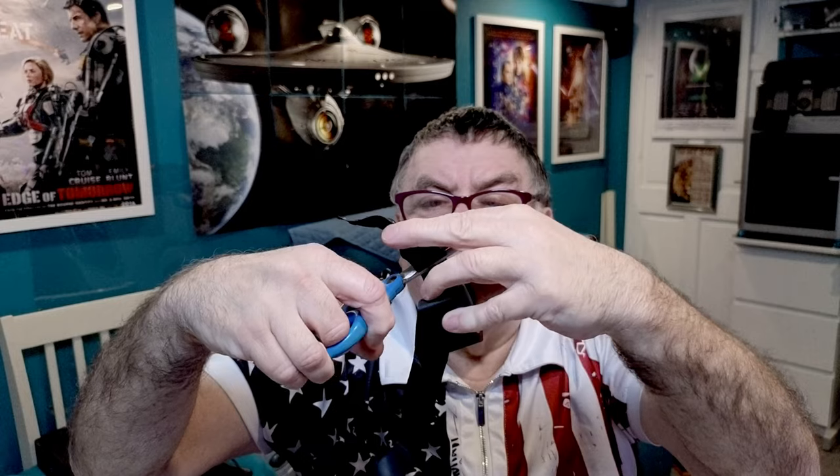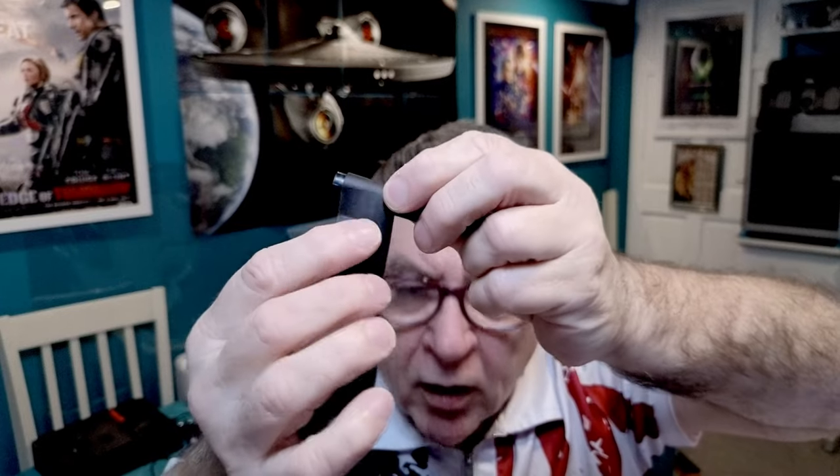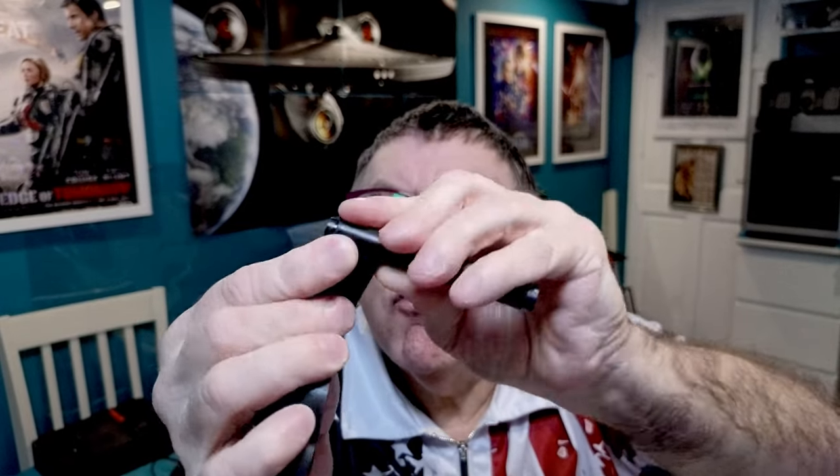And like I said, this one, I used this stuff. So I'll show you putting it on the old one. Like I said, that's how you get the tape. It's got a protective sort of wrap on it one side, but there is no adhesive as such. It just relies on the stickiness of the rubber, hence its name, self-amalgamating, the fact that it self-amalgamates with itself under heat. So you would sort of start it off, trying to work backwards to the camera, but you'd start off, say there, stretch it out.